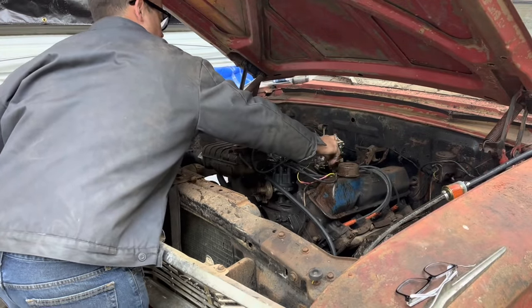Well, as you can see there, I got the dirt cleaned out of the inside of where the bearings go from where we ground all that rust off and cleaned up the bearings, got them greased up, put them in there, put the new seals in. One tip is with the seals, you don't want to try to tap one side down and leave the other side up. So you kind of want to tap around the edge evenly. And if one side's lower, you want to tap the higher side down.